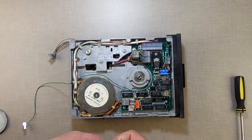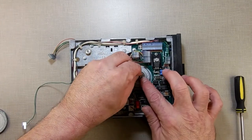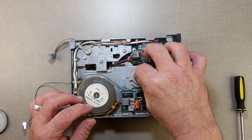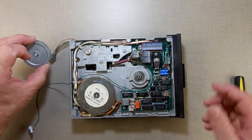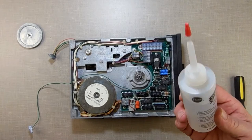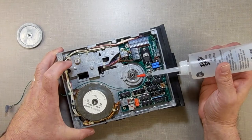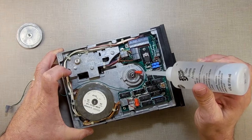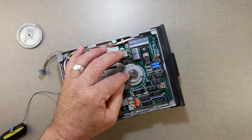There are a number of washers in here, so go slow as you're pulling it up. Don't yank them up or sideways. A couple of the spring washers stayed there — we just want to put them back on in there. The reason you close the door before doing this is if you don't, this little bearing or axle here will slide down and you can't get the screw back in. Now, I've got sewing machine oil — that's all I'm going to use. I'm going to put a couple of drops right here into the bearing area.